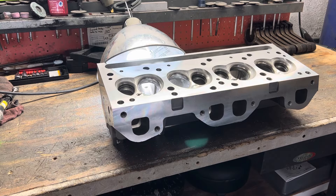Right now I'm just doing a little bit of measuring. When I'm doing the throat percentage, Speedmaster set the intake throat percentage at 90%, which is normally what I shoot for when I'm porting a set of cylinder heads. The issue is the casting has a little bit of core shift that's directly affecting the alignment of the intake ports.